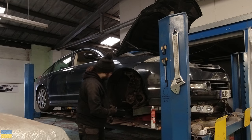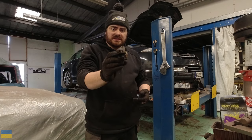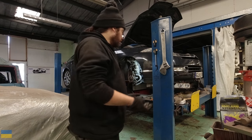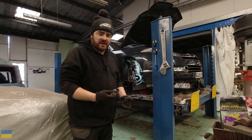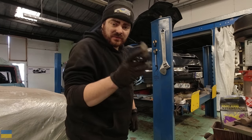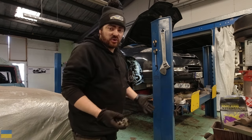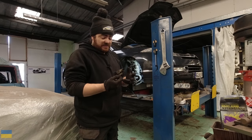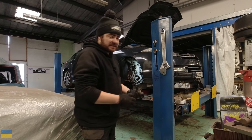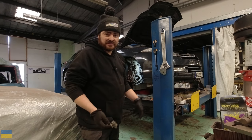It's got twin pot calipers and one of the pistons is bigger than the other. There's a sensor here too. On an old Citroën with green blood, you have a mechanical valve on each anti-roll bar — one on the front, one on the back. On the C6 you have electric sensors, one on each wheel, so it's not just doing it axle to axle — it's doing it each corner. When you set the suspension up on the C6, you effectively have to let the car corner weight itself: put in a load of figures, let the car find its balance, and it sets its own height. Nifty.